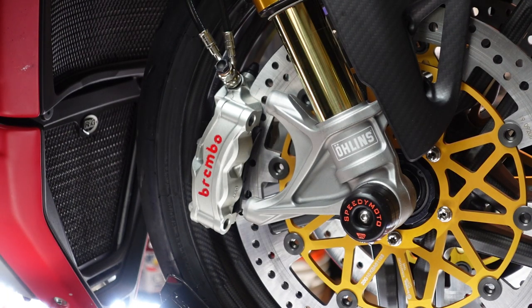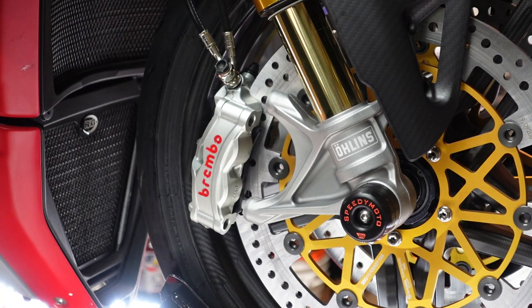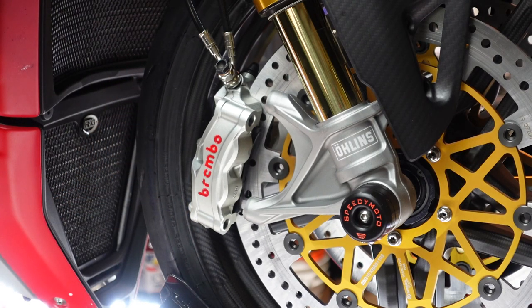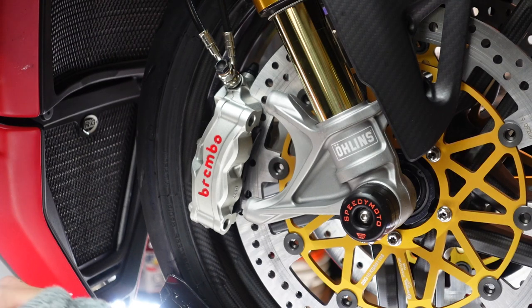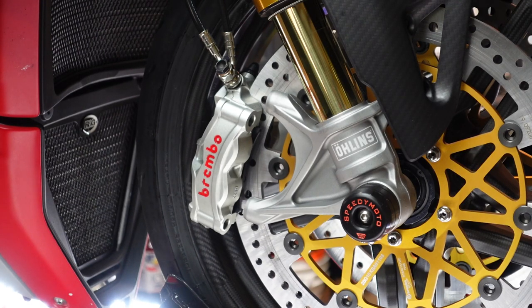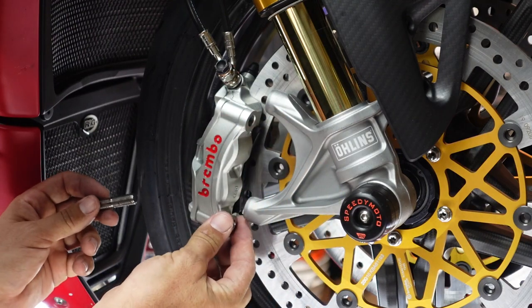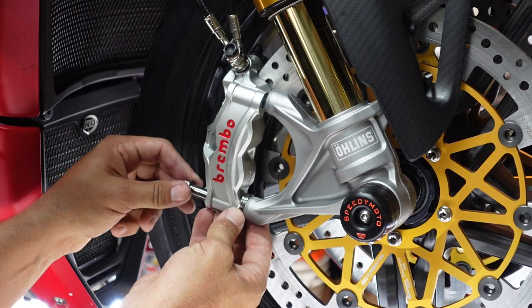So if you guys are interested in a brake fluid swap, what I would recommend is staying tuned for the brake master video. But we're going to get these caliper bolts kind of cleaned up, just the threads. Teeny bit of copper on there, just a teeny bit of anti-seize. Don't forget your spacer. Your spacer needs to go in, then your bolt, and you're going to go straight in